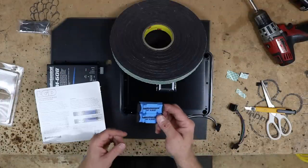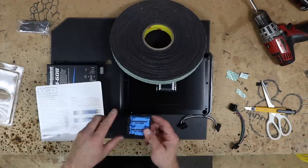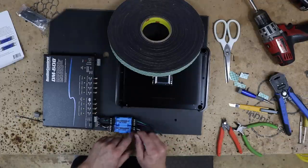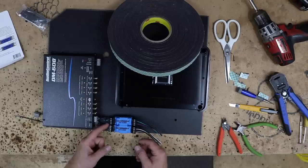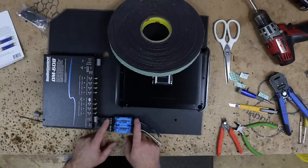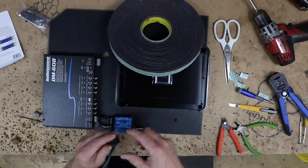And then of course we'll put this end back on here so that we can plug our new wire into this. They are directional, so when mounting them you want to keep that in mind, and it shows you right here. According to the instructions, factory amplifier outputs are going to go here, and off to the LC, or in this case the DM, are going to go here. Keep in mind, if you were to unscrew these off of here, they're not marked positive and negative anywhere along here. They do however match this side here, so as long as you have one of these with these wires still on them, they will match. The other thing too is that these will match the same pattern as the LCs, so just something to keep in mind. A lot of times you go at these and then you're like, wait a minute, there's no markings on here for what this is.